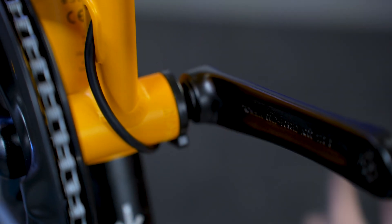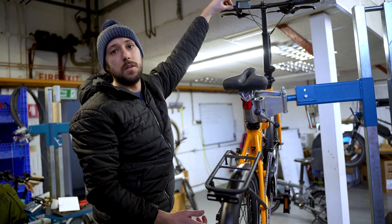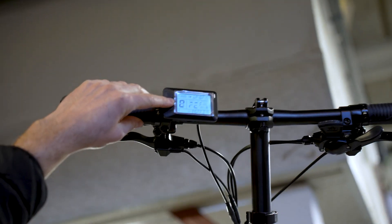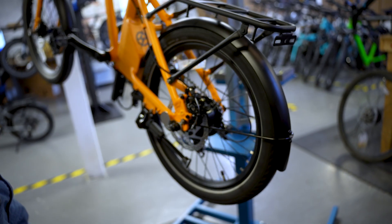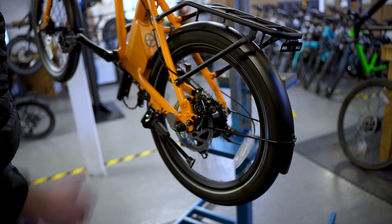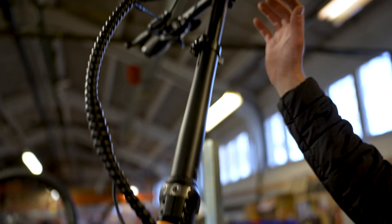While talking about the motor cable, the easiest test to do when not on the bike is the walk assist. If you turn on the display and hold down the bottom arrow, the walk assist should turn on — that's a good general test to see that the motor is working. If there's any issue with the motor cable connection, the walk assist won't work and you'll get an error message flashing up, so if it's working you know the motor is healthy.